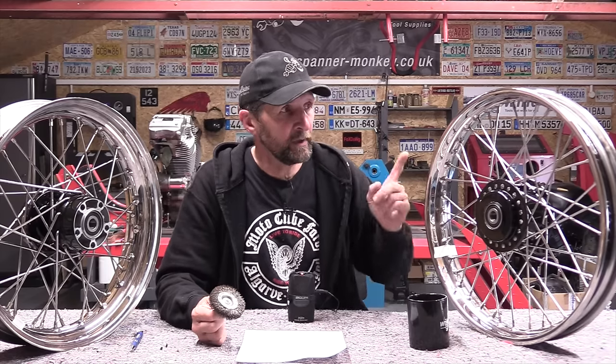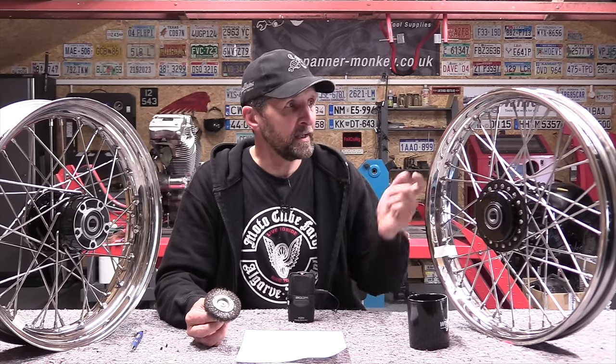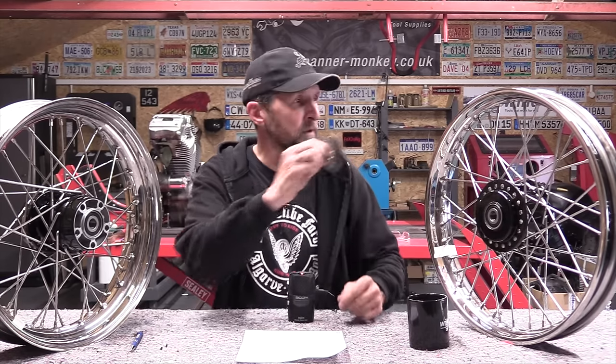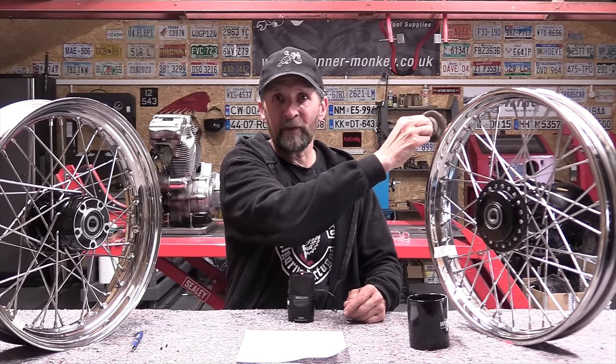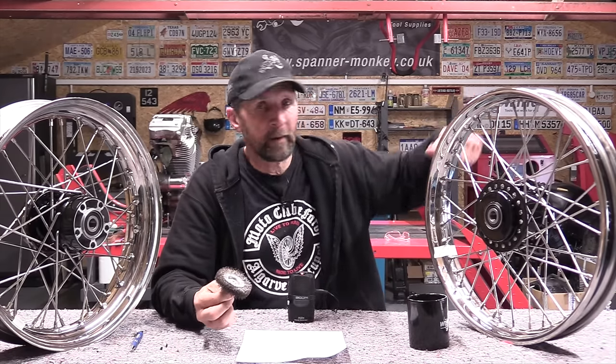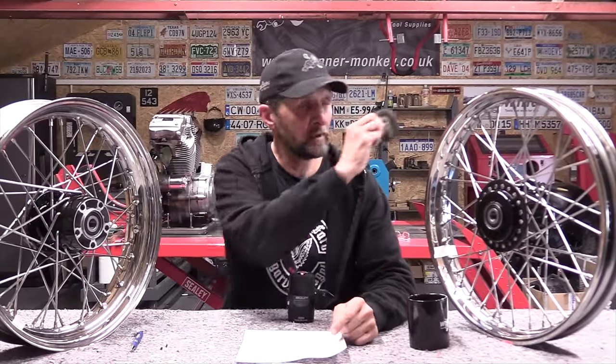If you're going to true a wheel, you always take the tyre off, obviously, to allow it to true itself up. And then when you adjust the spokes, identify which ones you want to adjust. Take a little wire mop on a drill and just buzz the sealant off the end of that spoke. Piece of cake, it just comes straight off. And then afterwards, just spread a bit more in, job done. So yeah, you can adjust the spokes with a wire mop, grind them off the end.